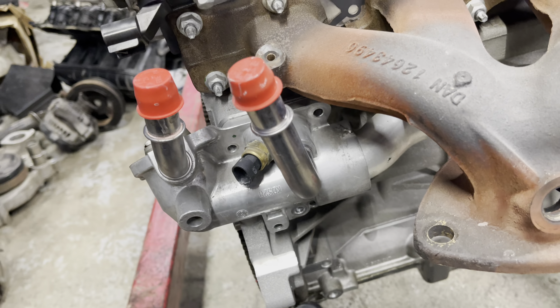In the car you might need to use a mirror. I can get my fingers in — I have small fingers. If not, you might want to use a magnetic socket. Get one in there, number two, and then the third one's a little hard. Just be careful you don't drop the bolt down into the timing cover. Got all three bolts in there tightened down. Now there are two long 13s and two short ones — the two short ones go through the back. It'll rotate just a bit so you can get the bolts lined up. Another short bolt goes up top, and the two longer bolts go next to the motor mount and below the water pump.